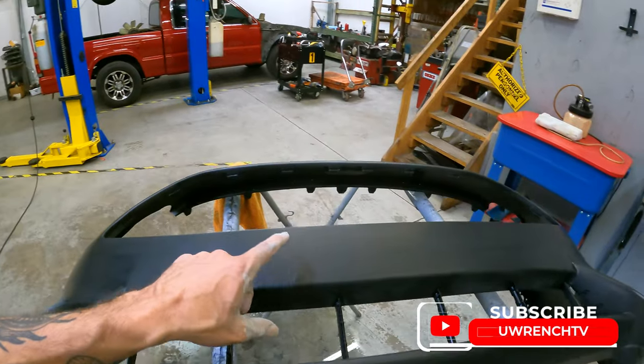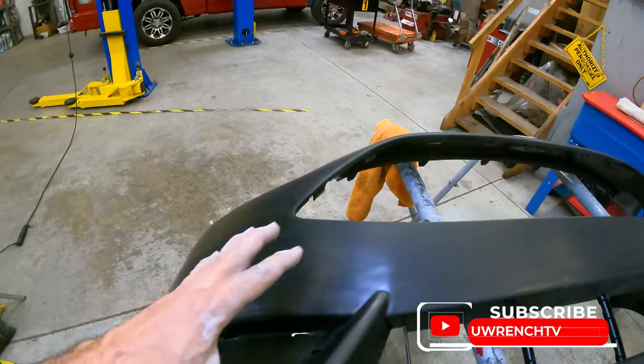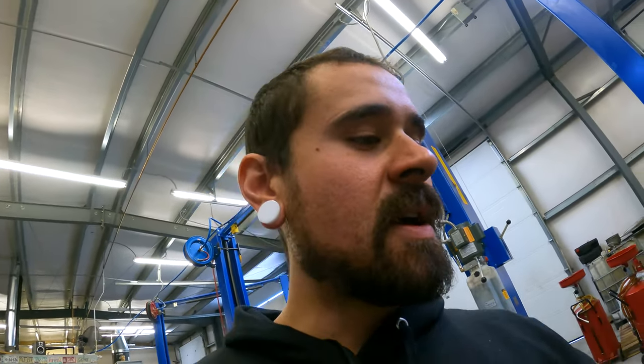But one big thing I want to fill you guys in on about plastics. It's really tempting for a lot of people, whether you've painted before and had problems with adhesion on plastic, or you're trying to avoid that, to quickly resort to a really heavy grit. For a bumper cover, I'd consider anything heavier than 1,000 or 800 heavy. With raw plastic, if you go heavier than that, so 500, 320, whatever, especially on metallic colors, it's going to show. You'll get nasty scratches, and even if you seal it, it's probably not going to fill them in, and then it all swells back and you have really weird sanding marks in there. Honestly, you're not doing yourself any favors.